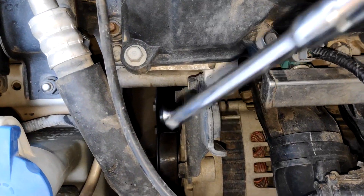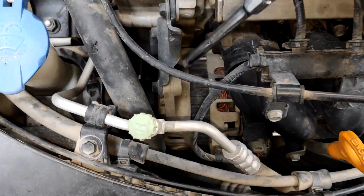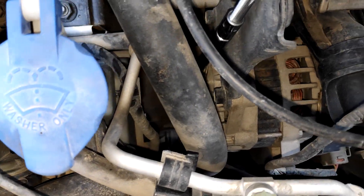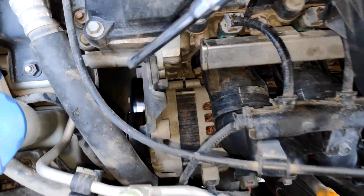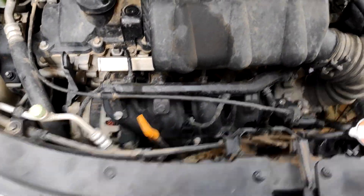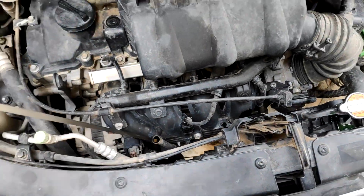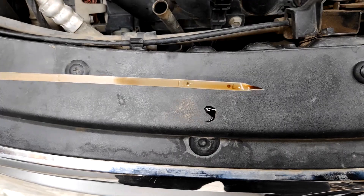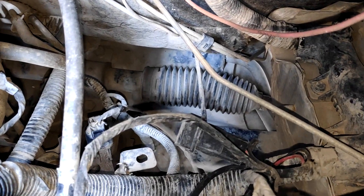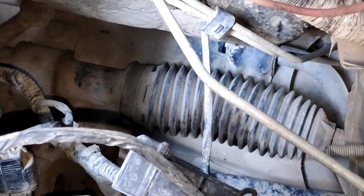This is the alternator which is driven by this pulley from the engine. If you want to see the parts inside an alternator and how to dismantle and assemble one, you can watch this video by clicking the i button or following the link in the description. If you have to check the engine oil level and the quality of oil, this is the position of the dipstick. Here you can see the markings as F and L, indicating full and low. The strut that you see right now is part of the steering rack, and the entire column is the steering rack.